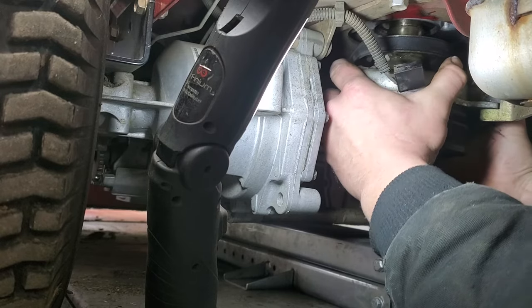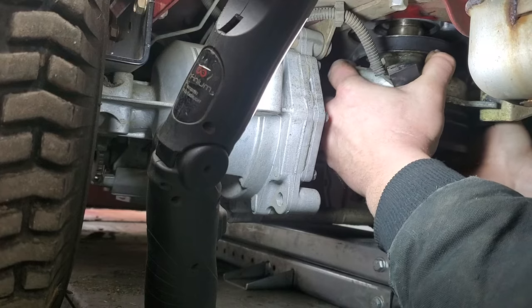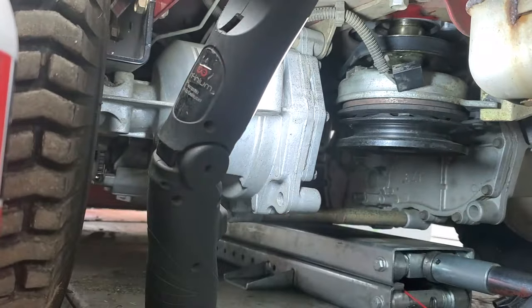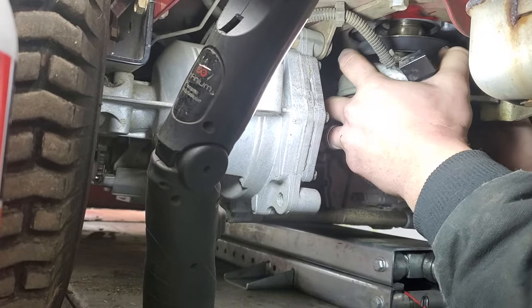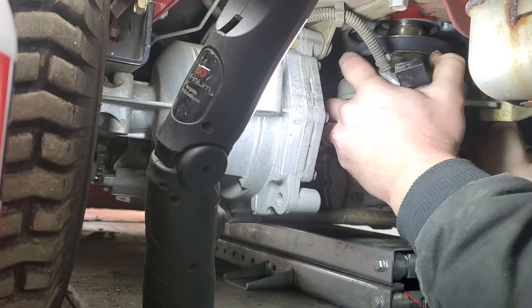I'm just kind of working back and forth here. A lot of times they'll just fall straight off — it really just depends on what's actually there holding it on. A lot of times there's a bunch of debris. We're going to spray one more time up there and get a little bit more lube right in between the top pulley and the clutch. Push back up once — when it comes right back down, it should pop right off of there.